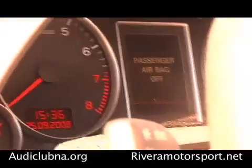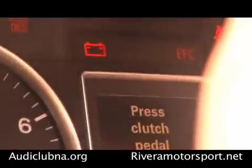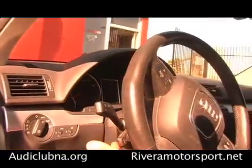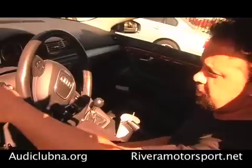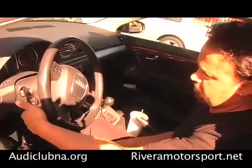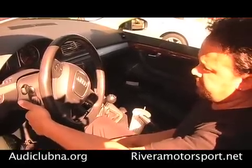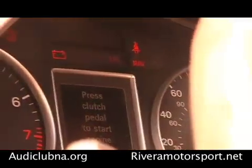So next what I want to do is, if you have a security code, you have to unlock it — it's automatically locked when you reflash a car with a security code. To do that, you have to make sure the cruise control is set on. Then you put the code in by moving: first you go down to confirm, then you move up the amount of digits for the first digit — in this case it's two, so you go one, two — then you go down to confirm. Then you put the rest of the digits in. Now you see the lights are flashing alternately, which means the security code was entered and it's now unlocked.